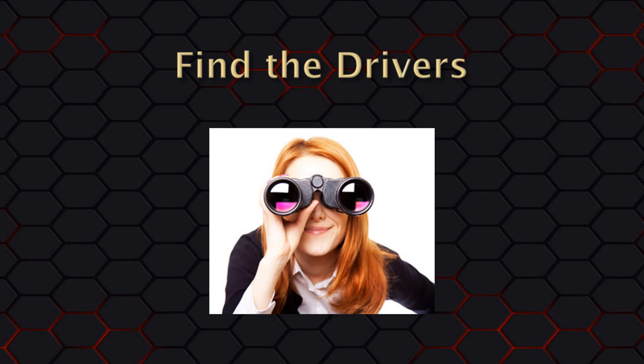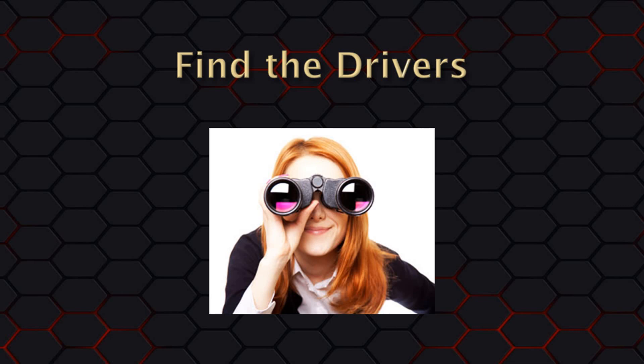You can also check all of your track gear — USB to serial adapters and USB timers should have come with a mini-CD or a regular-sized CD that has the drivers on it. If you have that CD, you can try installing the drivers from it. However, if you have an adapter or USB timer that is several years old, those drivers may not work with newer versions of your operating system. If you are unable to find the drivers, then all hope is not lost. Many of the USB to serial adapters and some of the USB timers have a communications chip inside them made by one of two companies: Prolific or FTDI. You can try going to the Prolific and FTDI websites, getting their latest drivers, and try installing them. Make sure to check out the notes on those websites that may apply to your version of Windows.